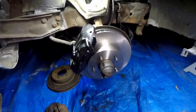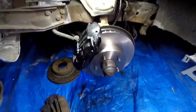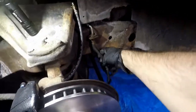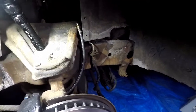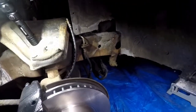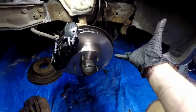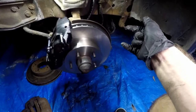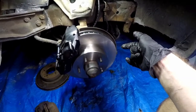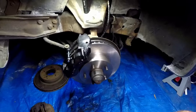As you can see, the brakes are on. We got the rotor, the caliper pads, and I even got the soft line in. Both of these were just stripped — this one was stripped so I couldn't even get a bite on it, so I just tore the hose off to get the caliper off. I'll figure out a way — I think I can twist down here and just rip it. These are just the AC Delco stock replacement brakes, basically. Not a performance upgrade or anything like that. This is not going to be a car that I'm driving really hard — I just need brakes that work.